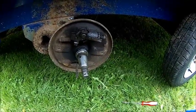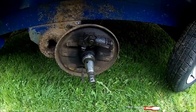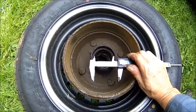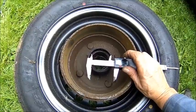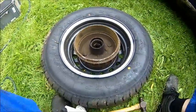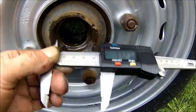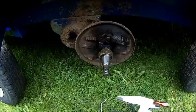Let's put the wheel back so we can move it away and order the bits, then we'll carry on doing the rest of it. The outer diameter on the inner bearing looks like 2.25 inches — about 57mm. The outer bearing looks like 1.75 inches, which makes sense. Let's put it back together, order the bits, and then we'll come back.